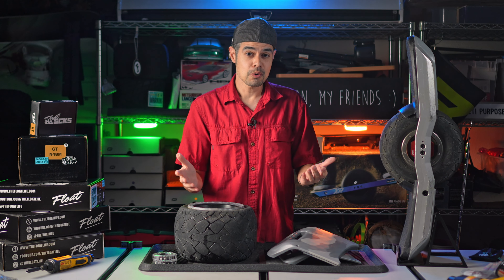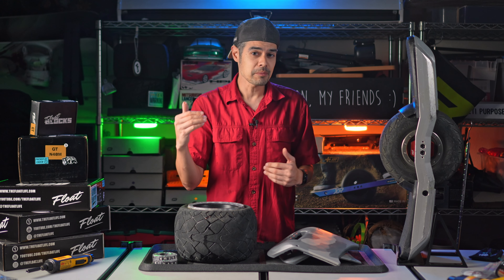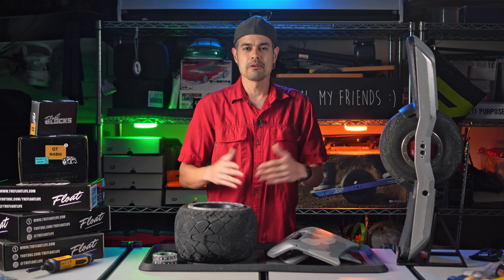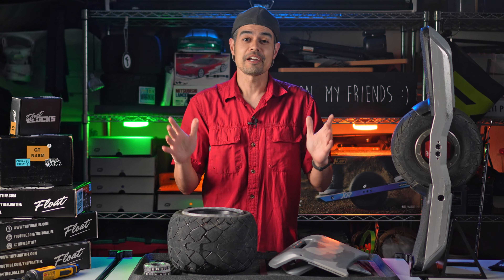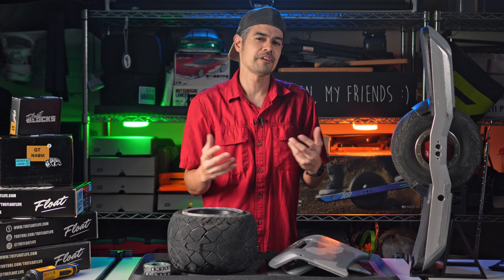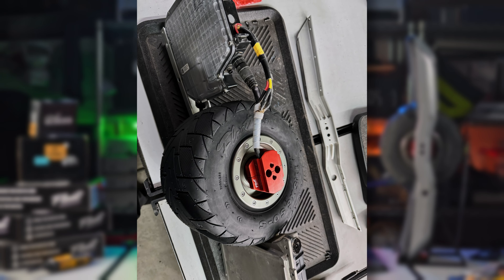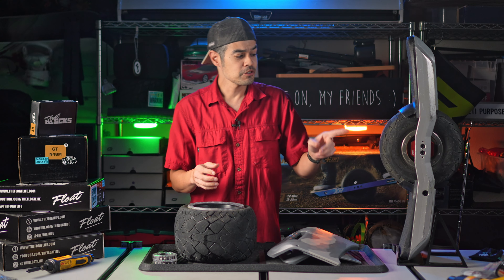It's only been a week so we'll see how it wears. My only complaint is the speed wobbles. I did try airing up the tire to 20 PSI for maximizing battery and range for street riding, but it got more wobbly, so I aired it back down and found that around 13 PSI was a good middle ground if I'm planning to do both streets and a little trail — but I might lower it even more if it's going to be a really bumpy trail. As for the float block axle carriers, it's hard to give feedback as it's hard to prove axle strength effectiveness, and it's not quite summer yet to test motor overheating — but it did give me more slack on the motor cable, it looks freaking cool, and the fins did feel warm after a hard ride, so it is dissipating heat.